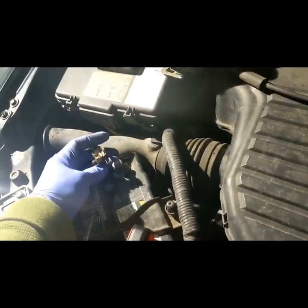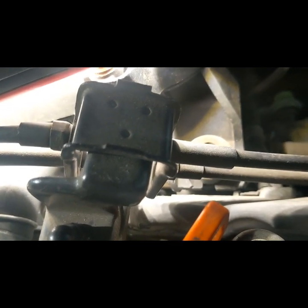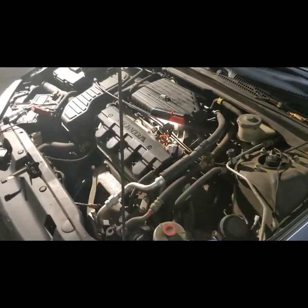I've got the key turned all the way, I unplugged the negative cable, and as I touch it I should hear the injectors spraying gas. I can hear the pump trying to pump but I don't hear any gas coming in. That sounds like a fuel pump clogged up, a filter clogged up, or the fuel pump is leaking back out.